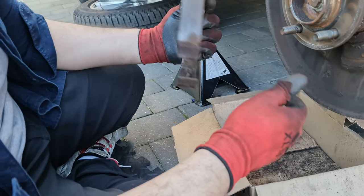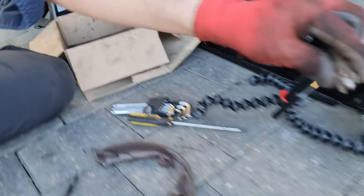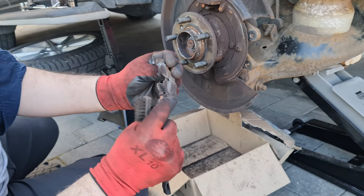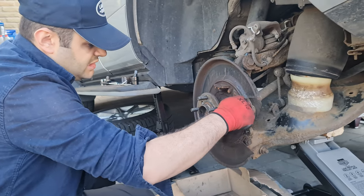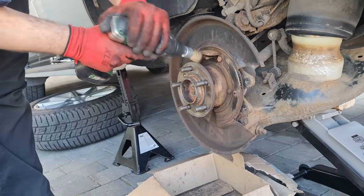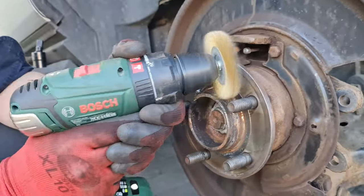We disconnect this and that's the old brakes done. Let's remove the rest. Actually there's no need — I'll just spread it apart and keep it there. Next is the cable — there's a cable inside. All you do is do this and it comes out that way. Now we're going to tidy things up and do a clean-up of all of this. Make sure you clean this hole because that's where the pin goes, same thing on the other side.